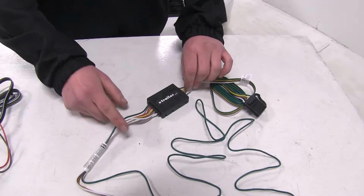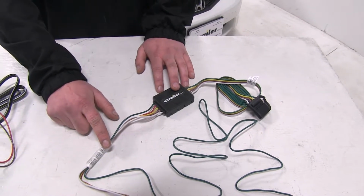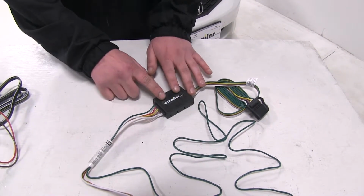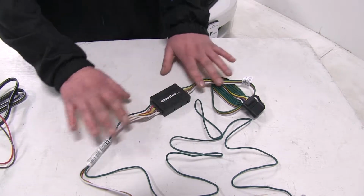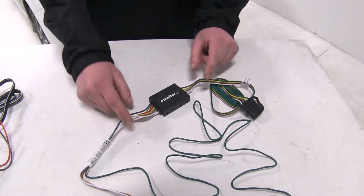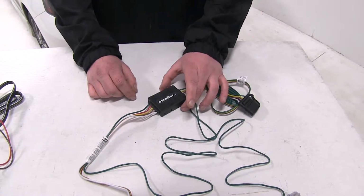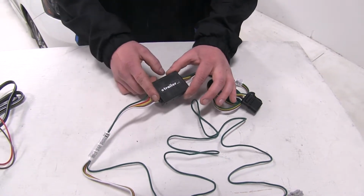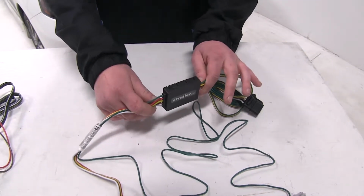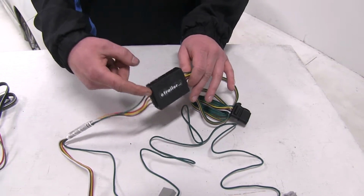While the Curt has its 4-pole connector coming out one side and the rest of its vehicle wiring coming out the other side. Now this can be a benefit in some ways by separating them, but it can also be not as convenient as the Tekonsha because it can take up a little more space. And the most common point for water entry inside the control box is the connector. So ideally you would have your wiring facing down to prevent any water from collecting on the ends.